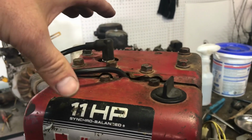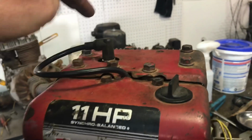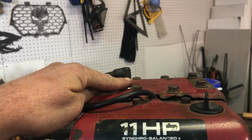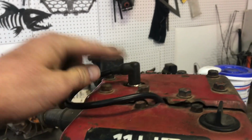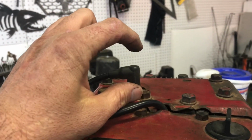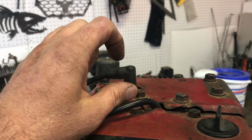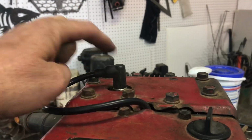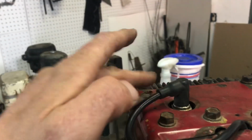As you guys know, that 12 horse sits pretty short, so this engine sits up, and I've got about that much that hits my seat. Rather than changing the seat mount, I think I'm going to take a 3-inch hole saw and go up through that thick wood on the seat, not all the way through it, but maybe an inch, either 1 1/8 or 1 1/4. That way you won't go through the foam, but it'll still leave enough room to sit down over top of this.